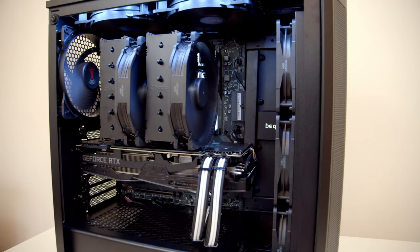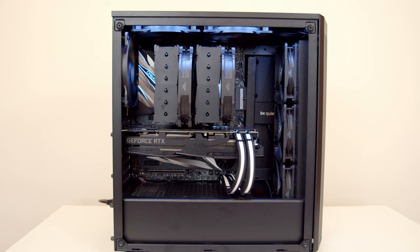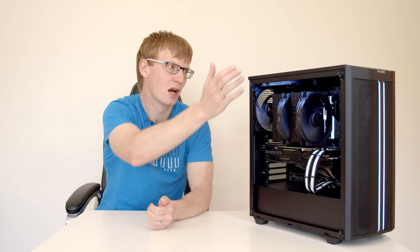Although we now had a quieter PC, both CPU and GPU were running hotter than I'd be comfortable with. To improve air cooling, I moved all the BeQuiet Pure Wings 2 fans to the rear of the case and occupied the front with three Noctua NF-S12A 120mm fans as intake. I then tested the Pure Wings fans in three different rear orientations. The first was two fans at the top as exhaust plus rear exhaust — three 120mm intakes at front, three 140mm Pure Wings exhausts.